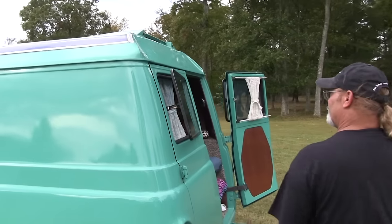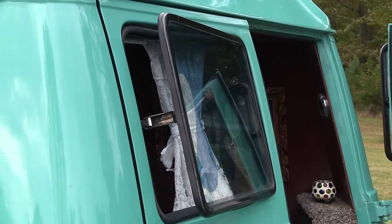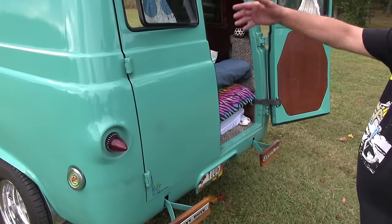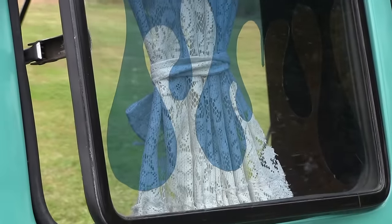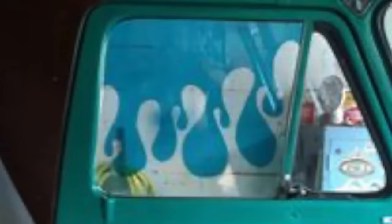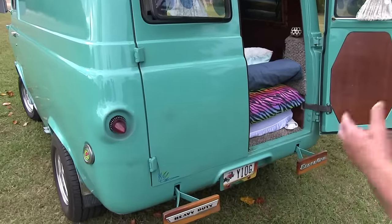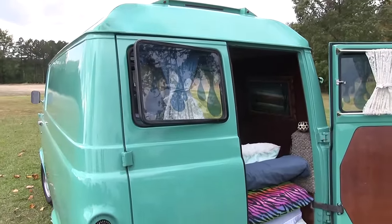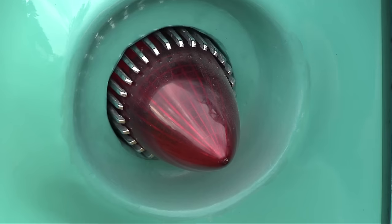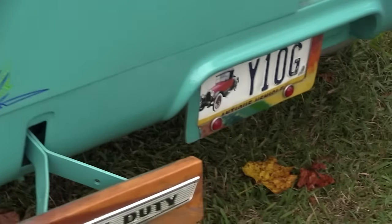I had regular flat windows and they normally didn't come with pop-outs unless on the side doors, but I figured I'd put a set in the back. The lava scene you see on the windows I did in my '63 — I was so fond of that van; it was like the love of my life, and I just transferred a lot of my vision from that van to this van. I did the tail lights and they're from a '59 Cadillac. I took the lenses out, cut them an inch and three quarters, and then Frenched them in two inches over.